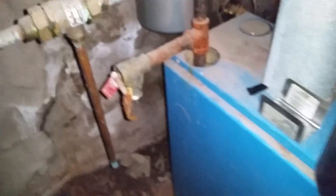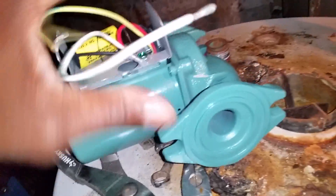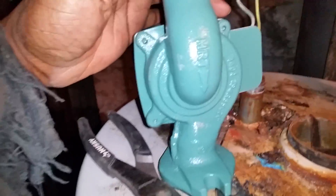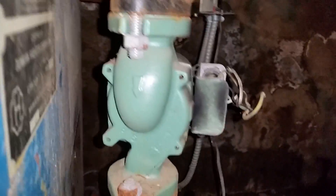Make sure there's no pressure on it when you're taking it off so you won't get burnt by any scalding water. I have the new one right here. You have two rubber gaskets — one fits in a ring right here in this area, and then you have one on the other side. Pay attention to which way the arrow is going on the pump. On this one, the arrow is going straight down. It always tells you which way the water is supposed to go. These are the gasket rings that fit in that area.